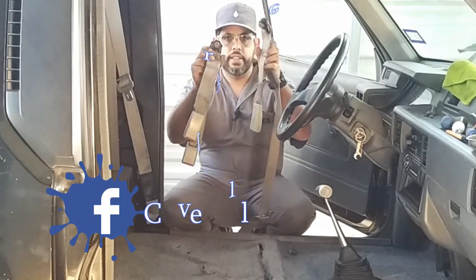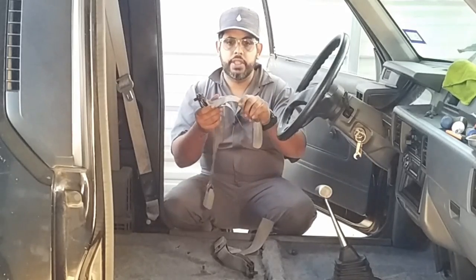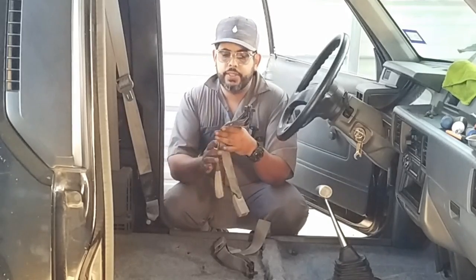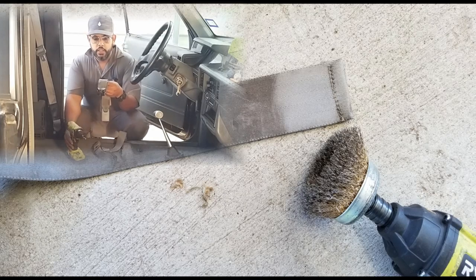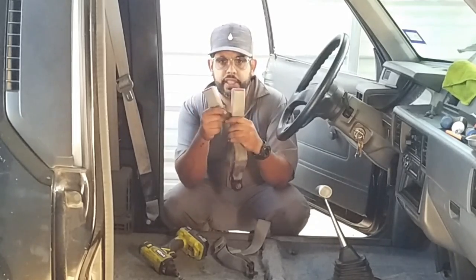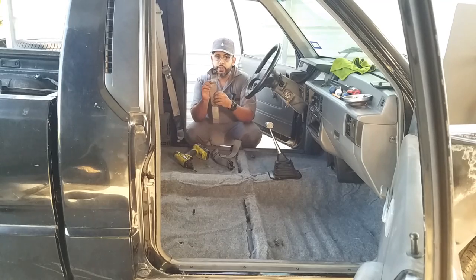Before I put the seat on, let's put on the seat belt buckles. I just refreshed and cleaned them, and I found a nice trick to restore old belts — only for old vehicles though, not recommended for newer cars or new belts. If you have old crusty belts, you can use a nylon plastic wire wheel on a drill. It works pretty well — takes off all the grime. It lightly brushes the belt and removes all the dark, grimy areas. Again, don't recommend it on newer vehicles, but for old crusty dirty belts it kind of works out and looks way better.